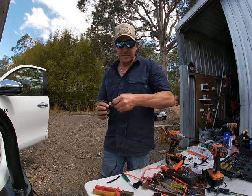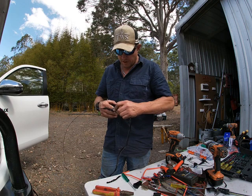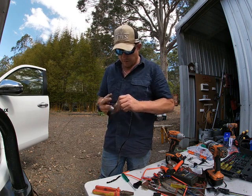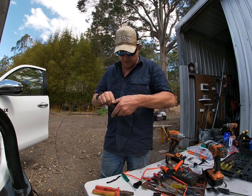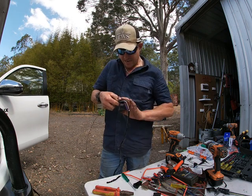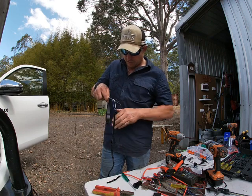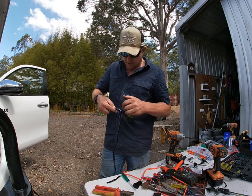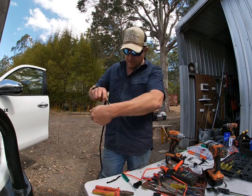So I actually found the better one to go through is going to be that other, that main grommet. It's got the wiring loom going through it. Just there's heaps of room on it. It's just going to slip through a hole in the bottom that I poked through with a screwdriver. You don't want anything too sharp going through there. Spend your time on this, because those grommets, you think they're not that rubbery, but they really are.